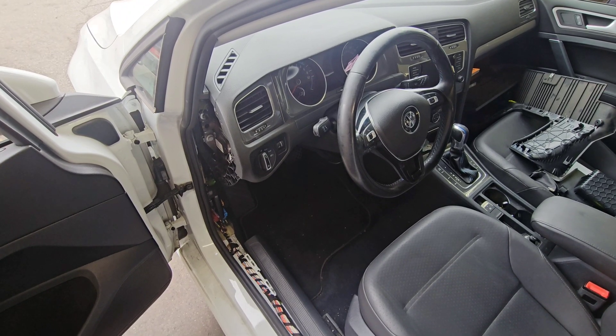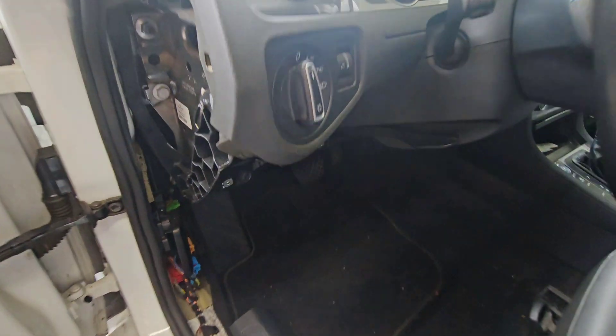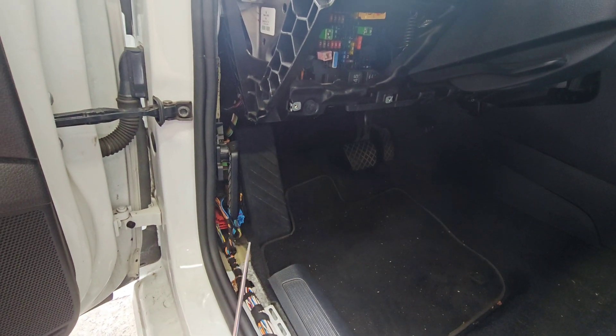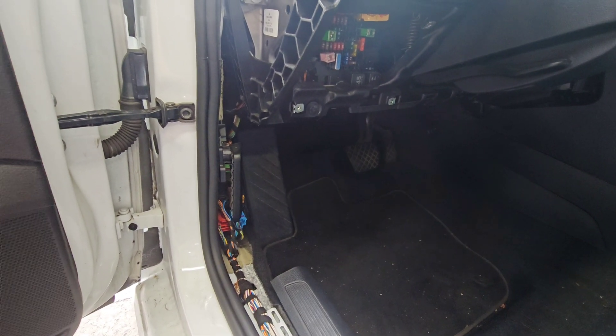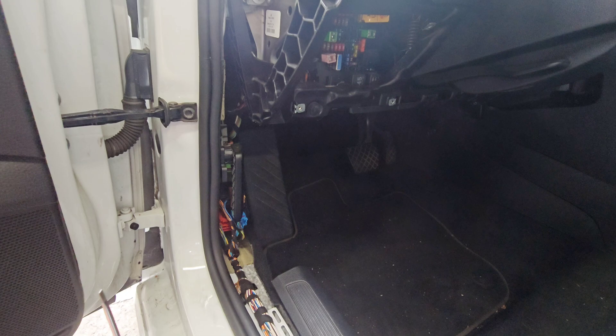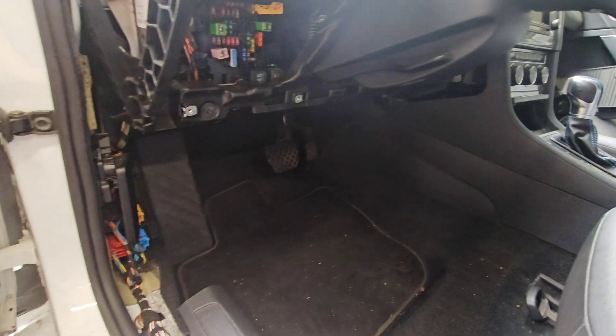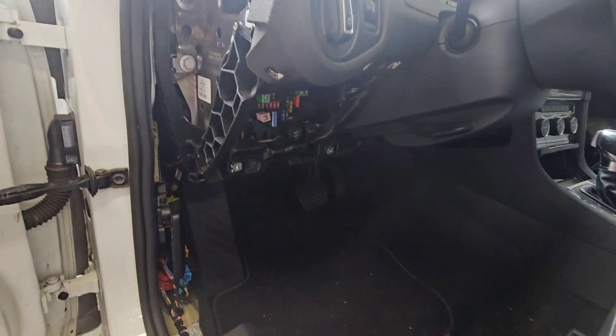The e-Golf now works and drives. I had to disconnect that alarm system and that GPS system — it had a remote start in it, and the vehicle would not start because it was killing power to the gear shifter. Now I have to put the covers back on.